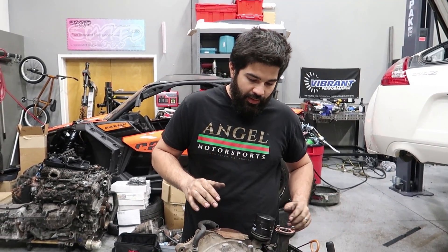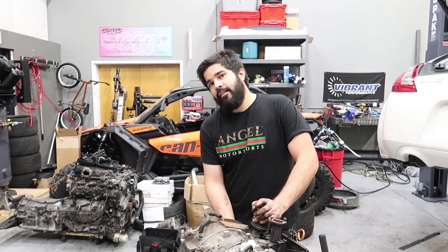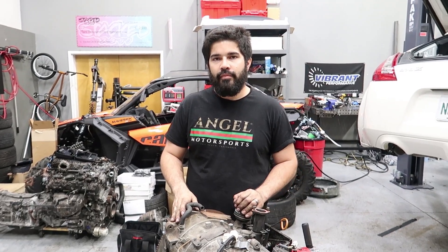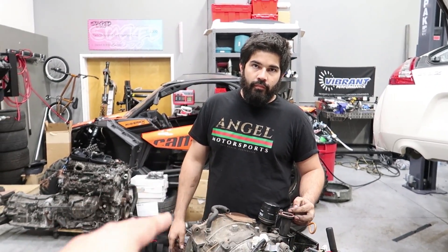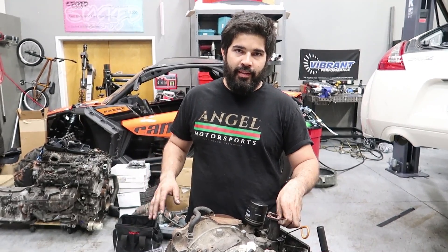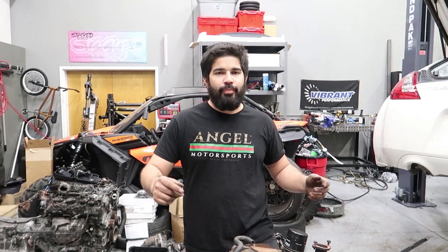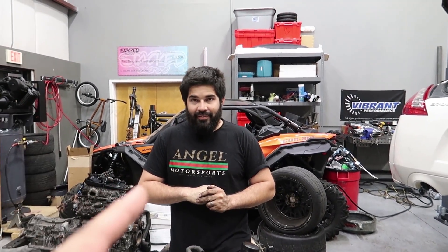The main question is how much power we can get out of this engine. Without pinning we can get 500 horsepower easily. With pinning we can get between 500 to 700 depending on fuel and boost. On E85 you could get close to 600 easily. If we're targeting 500 to 550, we'd still overbuild it for reliability. We always overbuild all our engines — I don't want to build it for 400 horsepower and then have a boost spike. The one good thing about a rotary: no matter how much boost we run, we're never gonna throw a rod out of it.